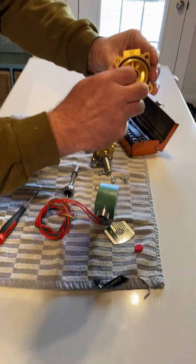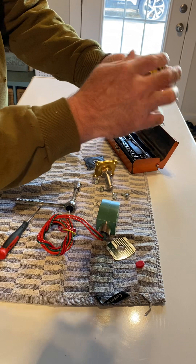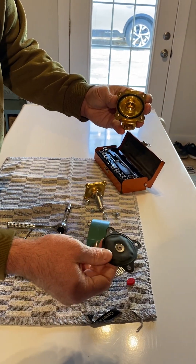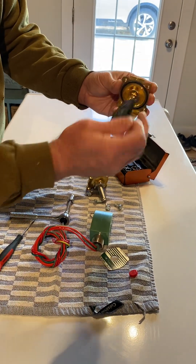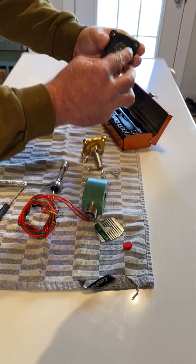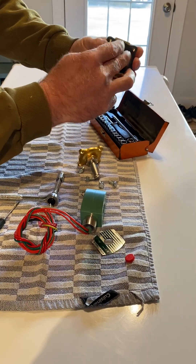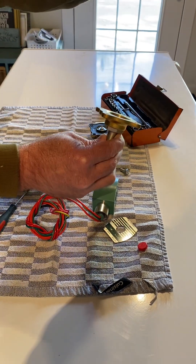There's an o-ring right here. Because these solenoids are designed to hold back pressure — whether it's a water valve, a pneumatic system, or whatever — make sure you turn the liquid nitrogen off, the water off, the oil off, whatever it is. Shut it off before you pull this apart, otherwise it's going to come gushing out. Now we're going to put this back together. Note that the o-ring usually comes with the rebuild kit.